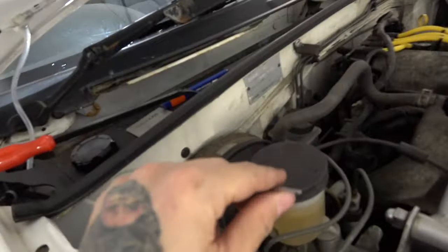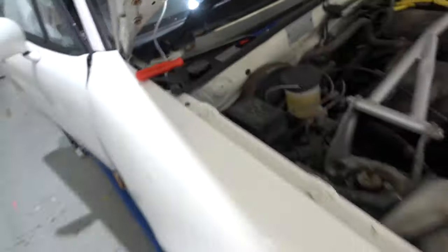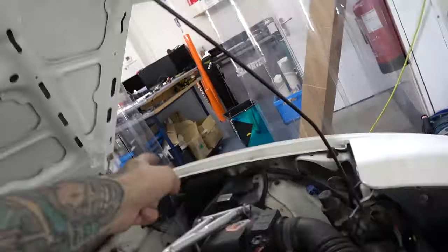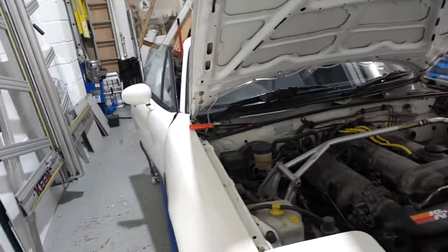In there there is a little rubber bung. After a bit of a struggle I've got a bit of wire through where the bung goes - there it is. I'm going to run the wires through there, make a little hole so it remains watertight and sealed, and then run the two cables out - one to here, one along the back under the wing and over to the other side. Hopefully that's the worst of it.